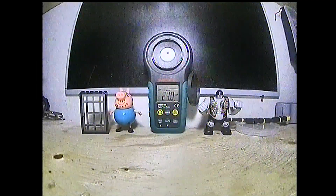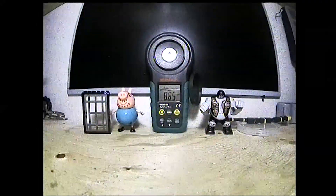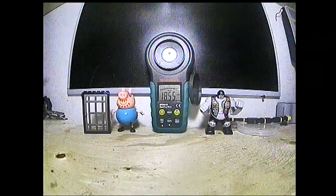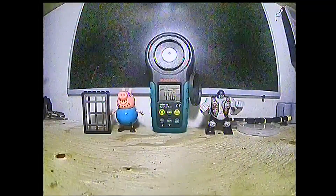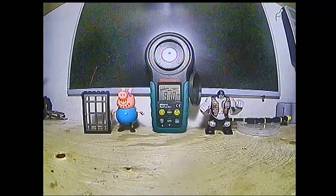In night mode, you can make out the meter at about 0.2 lux, and the ISO noise starts to clean up quite a bit around 0.5 lux, improving as you increase brightness. Having the two options is nice, but it appears the V3 is similar to the V4 with night mode enabled. Comparing images at 0.3 lux, the V3 appears to have a little less ISO noise, making the meter easier to read. The overall picture does appear brighter on the V4, so my original conclusion was a minimal improvement with a bit of a noise trade-off — though I couldn't help think I might be missing some crucial difference without a dedicated test for it.